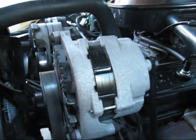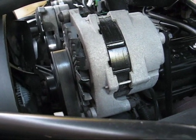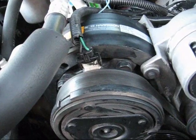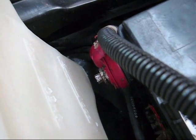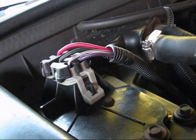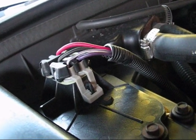Now back to my Cadillac Brougham. After going through some detail work using the lubricant on areas you're not going to get too wet, make sure you cover things like the alternator, the wiring harness on your air conditioning compressor, and your battery and battery terminals. You don't ever want corrosion on those if you want sure starts. The wiring harnesses you see — if those get wet, corrosion can begin, things can malfunction or short out, and electrical problems are so difficult to repair or even find sometimes.